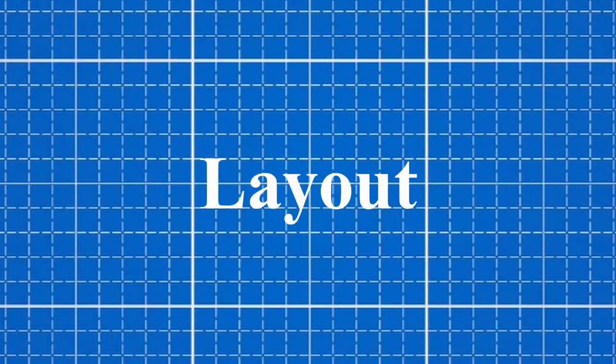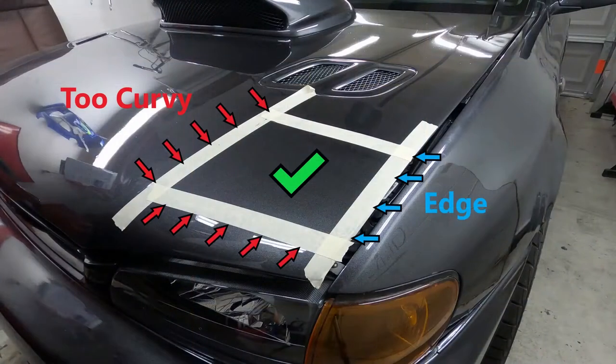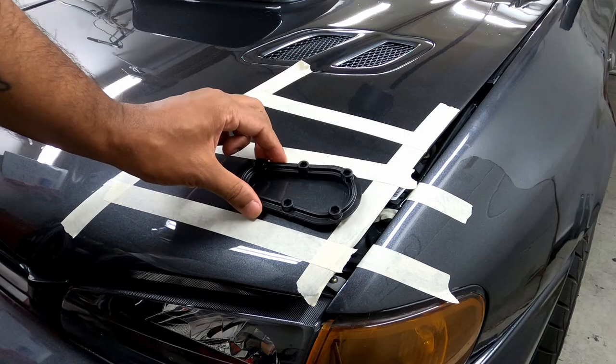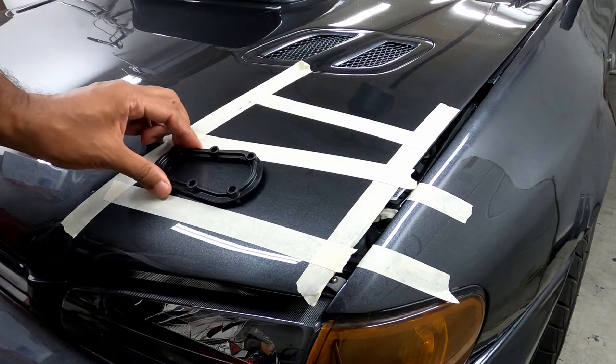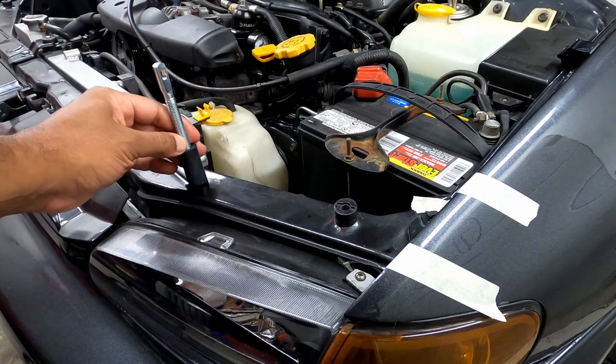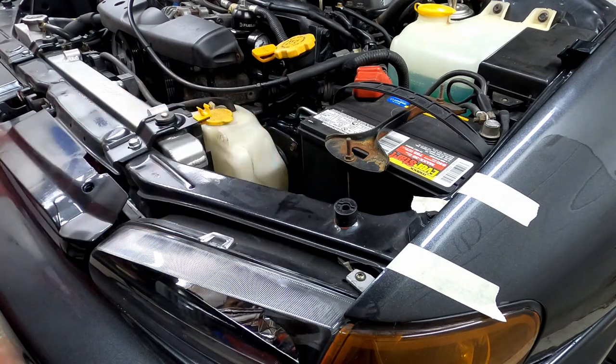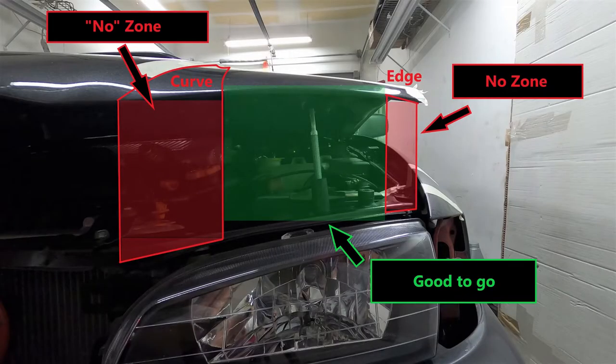The first thing you want to do is find a viable surface of the hood to install the locks. The surface should be relatively flat with a similar surface area with respect to the latch. Then there has to be a solid structure to mount the anchor bolts to. Once you establish those, locate where the anchor bolt holes will be on the solid structure. Make sure that location works with the flat surface of the hood, otherwise you could run into fitment issues.